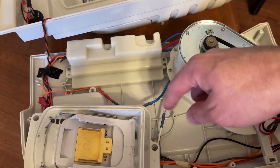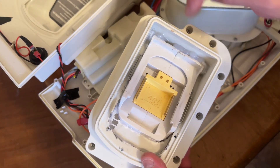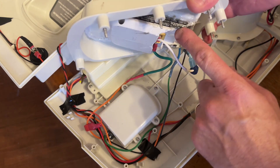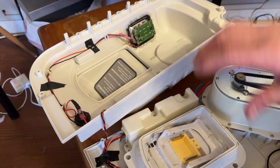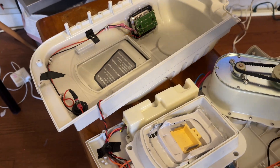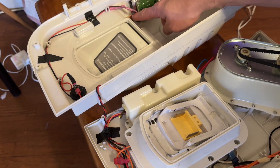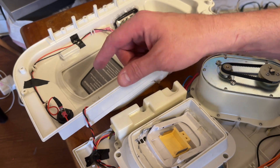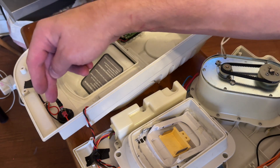I fed that around to the front — positive here, negative here. By the way, this is how I had to shave this piece. The next thing I did was wire this into the system: black goes all the way down and taps into the white wire — that's my negative. Red comes around going to this switch. I wanted a switch where I could flip it on and off; the original was just momentary — you had to press and hold it to keep the light on.